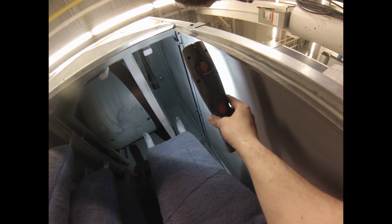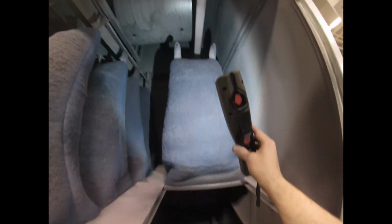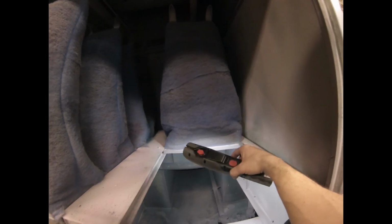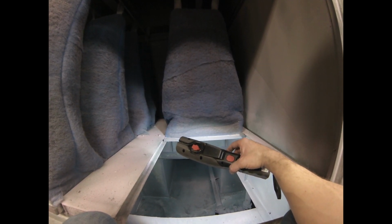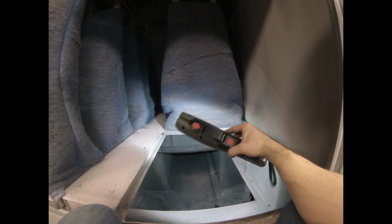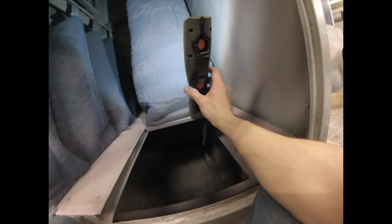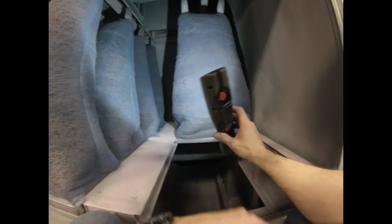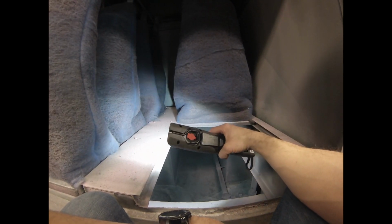You really have to watch and inspect the fans on the squirrel cage in this because they do get overspray built up in them, and then they'll flake off and imbalance the motor, and it can lose blades. Or not the motor, the squirrel cage, you can lose blades, affect the bearings and all kinds of different stuff. So you got to scrape them usually like once a year. If you take really good care of your filters, maybe once every 2 years or something like that. But it's part of the maintenance if you want the booth to last and not be dangerous in any way, right?